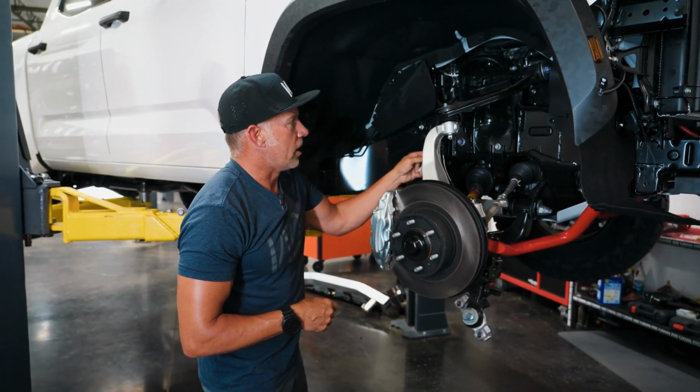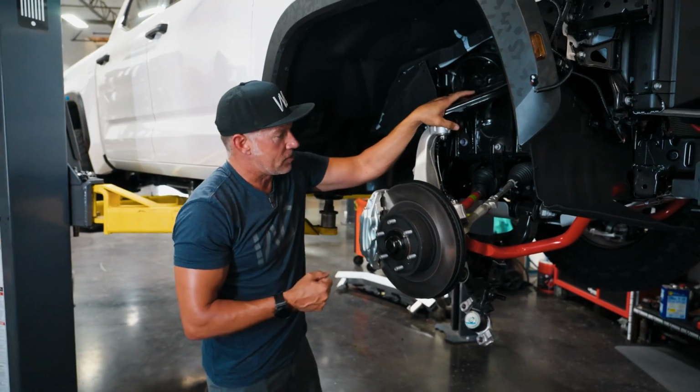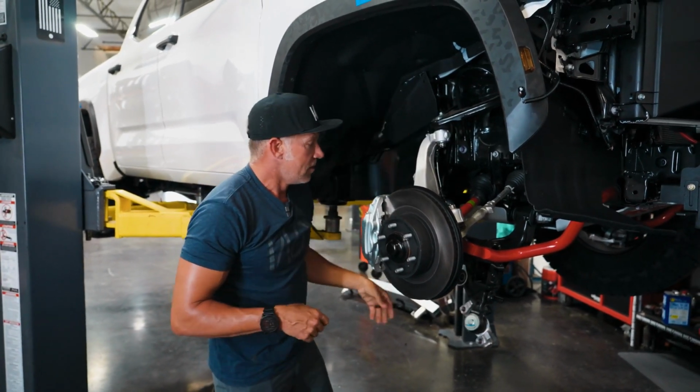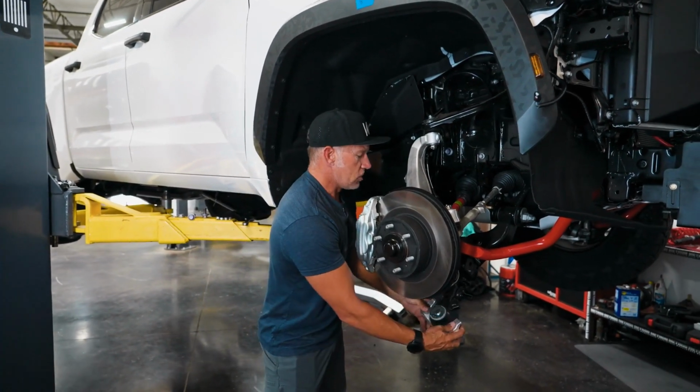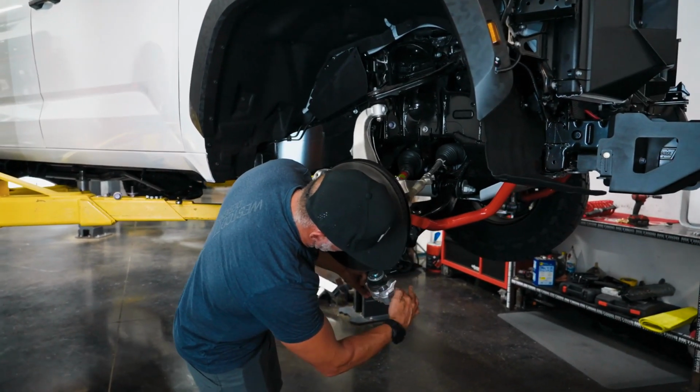We've still got room in the brake line here. We're not quite maxed out on the ball joint angle here. Obviously the strut's not in it. It's gonna put a little more force on this. The new lower spindle mount here is new for 23. They've actually opened up this window pocket more.